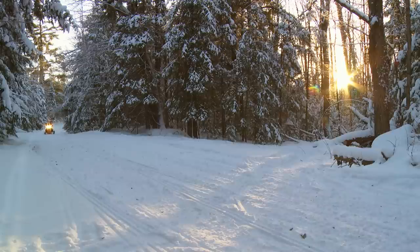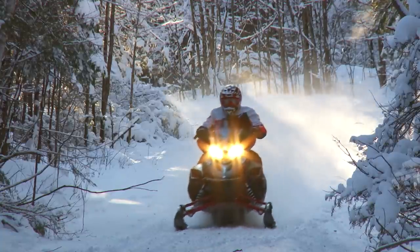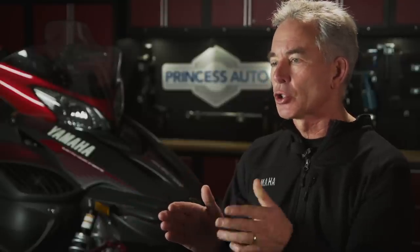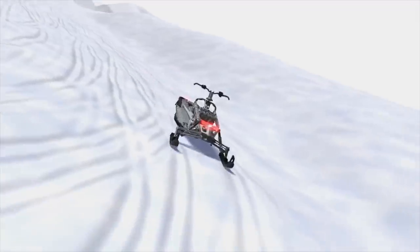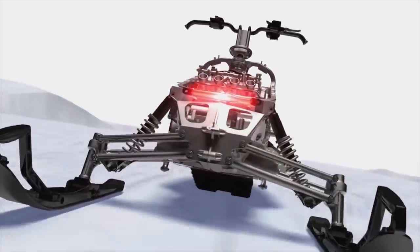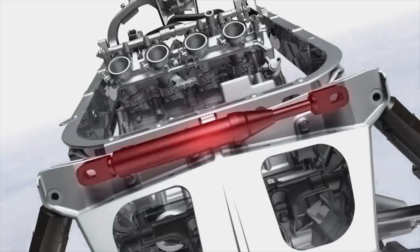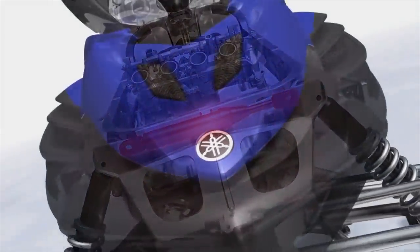When you give it a lot of input — if you were to try to push it an inch — the resistance it gives you back is incredible. Even though it's held in a centered point by pressure both sides, a negative spring and a gas-charged floating piston, if you were to push it out of center, it could take over 24 hours for that force to bring it back to center. Its reaction to large movement and big amplitude force is very slow, but its ability to react to vibration, real high-frequency quick-amplitude inputs, is amazingly fast.